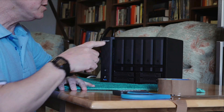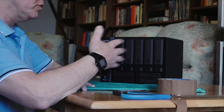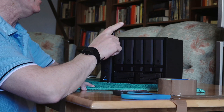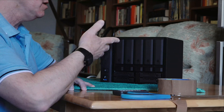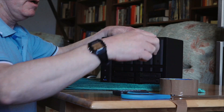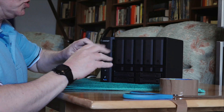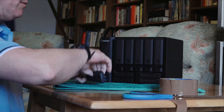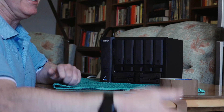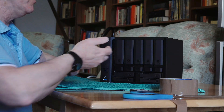Hi, today we are going to remove these hard drives and any solid state drives that could be in there. All the drives have to be taken out in order to upgrade the 8 gigabytes of memory in this QNAP TS-H973AX NAS. To do this we normally have masking tape and a pair of scissors. The tape goes on the module and then you lift it out — shaped like either a 7 or an L — because hands are very big in a small compartment, it's clumsy to try and get it out.